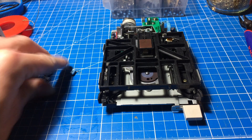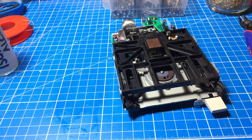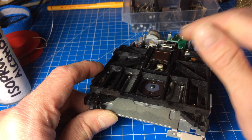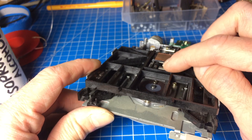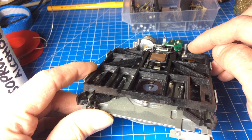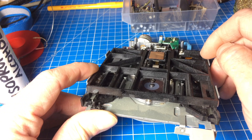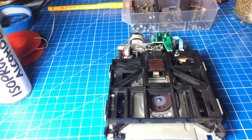Let's put the old caps away. Let's try and clean the heads. I'll try to angle this — it's not good if you pull on this too hard. You can see two heads there. I'm just gonna put a Q-tip or cotton swab between there that's soaked in isopropanol and rub very gently.